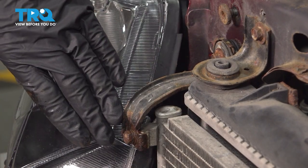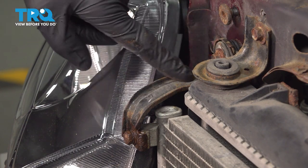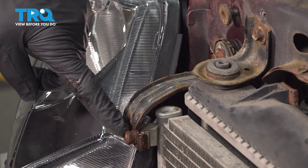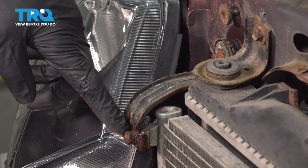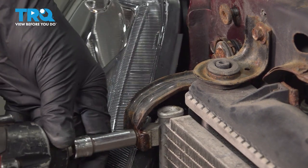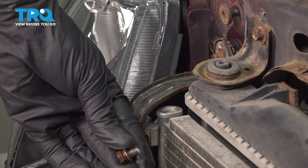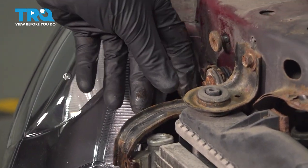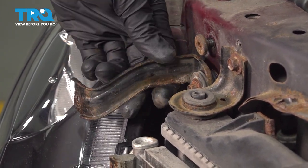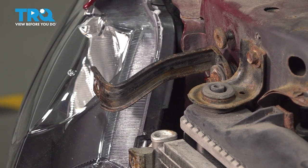With both of those lines out of there, we can start dismounting the AC condenser from the body of the vehicle. On each side of it, you'll find that you have a bracket. That bracket is held in place with a 10 millimeter bolt down along here, and then up along this area there's a small hook. Now we can take this bracket and carefully remove it from the area — I just spin this being extremely careful not to touch the headlamp assembly because I do not want to damage it.